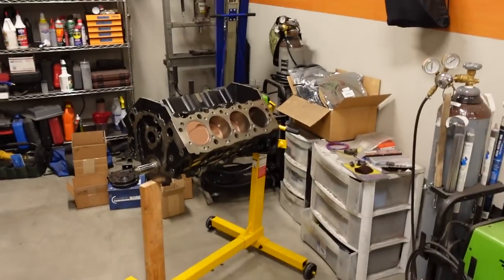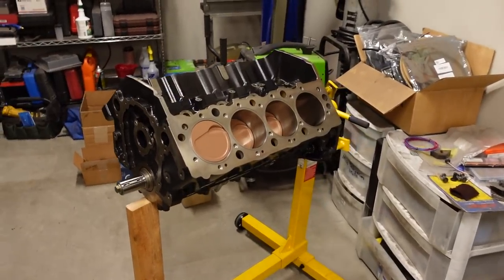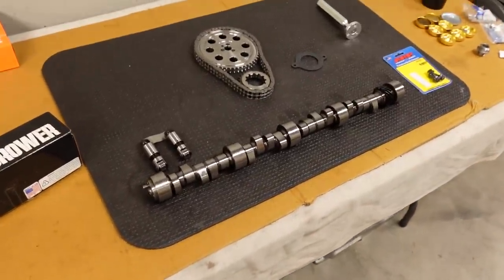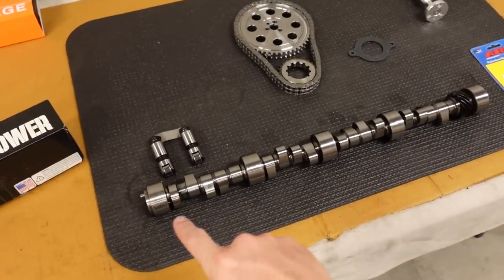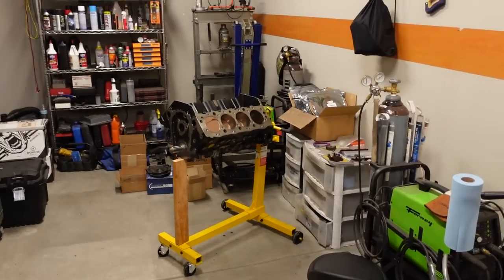Like, I'm not going to be spinning this engine to 7,000 RPM. It's probably going to have a ceiling of maybe 6,200, maybe 6,500, somewhere in there. Anyway, the cam, this is a solid roller. The only bad part about it, which actually I don't think I would even consider a bad part, the only difference is this is a traditional big block Chevy firing order, where normally the Gen 7 big blocks use